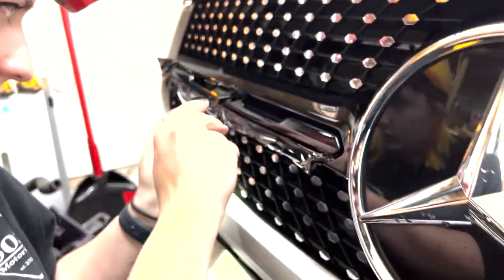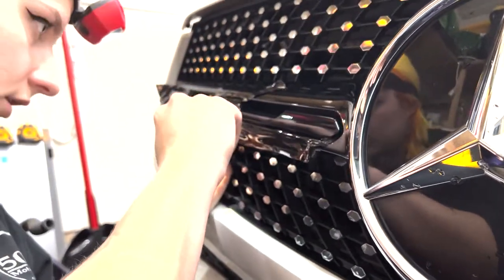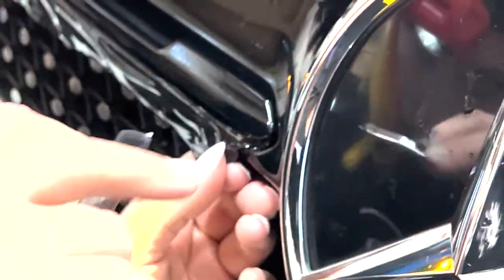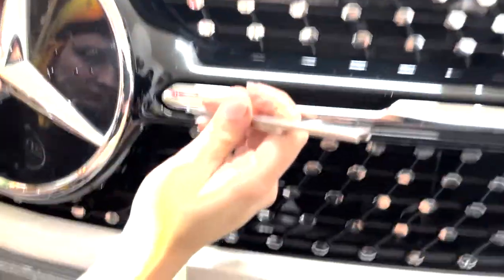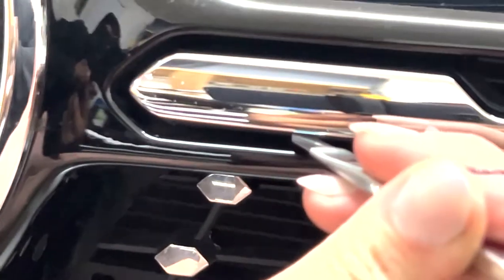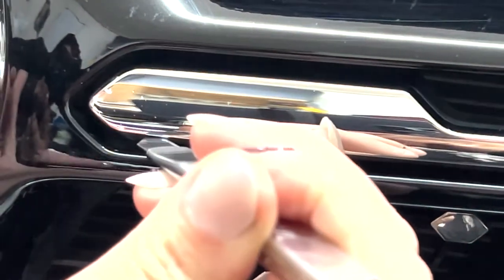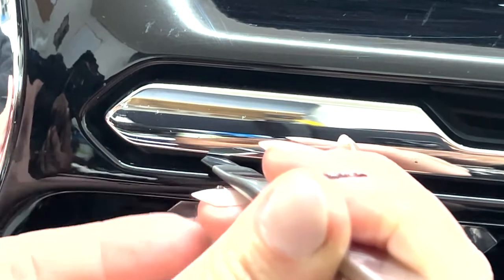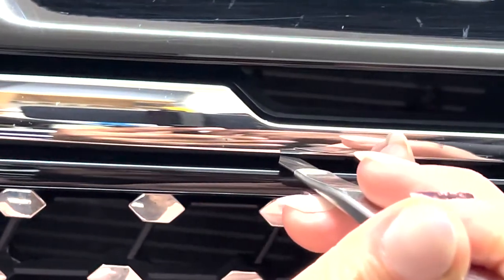On the bottom ones, I usually do a guessing cut essentially. So I'll get right in there, and I'll push my blade against the chrome. A good way of showing you: you're not necessarily flat, but rather you kick your blade out a little bit. What that does is it runs this back edge against the chrome and just glides. Instead of going flat against it, which could potentially cut right into the chrome, you tilt it a little bit and it just runs right across. Gives you a straight line too.